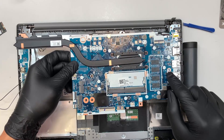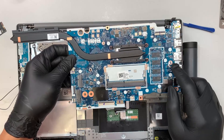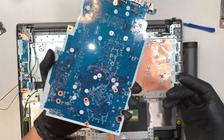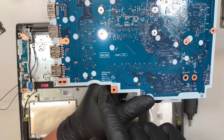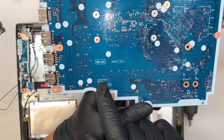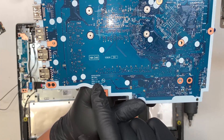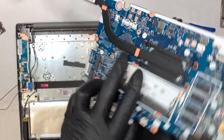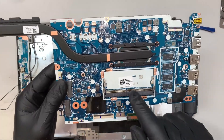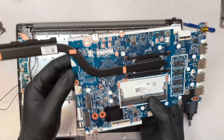There's one tiny screw right here which is the manufacturer warranty void screw — once you break that seal the warranty goes away. I just wanted to tell you there's one hidden screw right there. If you flip the motherboard around, you can see the model number: HS45A or HS55A. This was built in November 2020. This is the entire motherboard — if you're interested you can change it out, or look for the product number right here, which is also the serial number for all replacement parts.